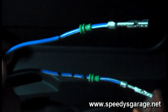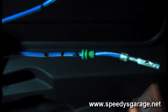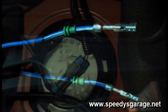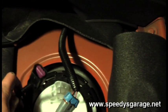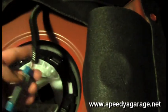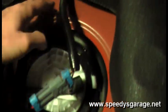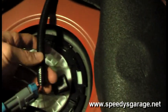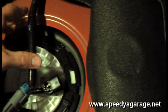One thing to remember: there are two blue with white striped wires for the fuel level transmitter. Make sure to mark the one that was in pin 3 with three marks, and the one in pin 1 with one mark — identify them so you don't get those mixed up. I've got the relay power and ground connected up, and there's the fuel gauge transmitter that'll connect to the top of the fuel hat. I decided to fold the factory wiring end over end and tuck it inside some corrugated tubing, leaving all the original factory wiring intact for future reference.